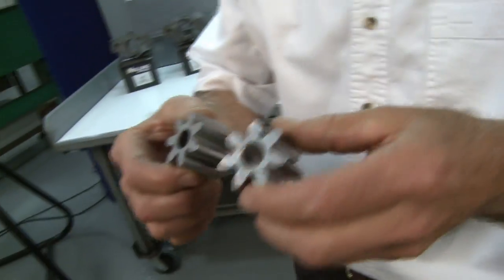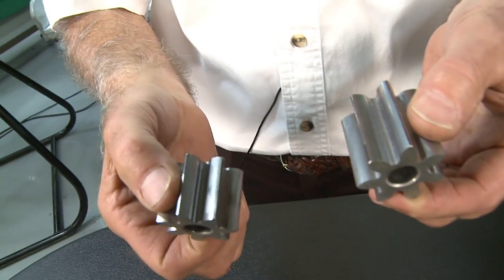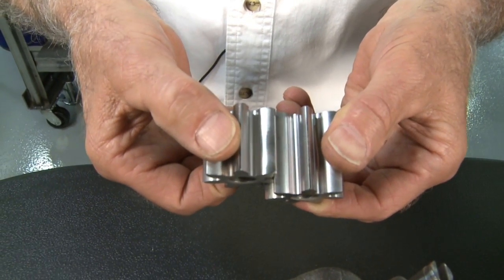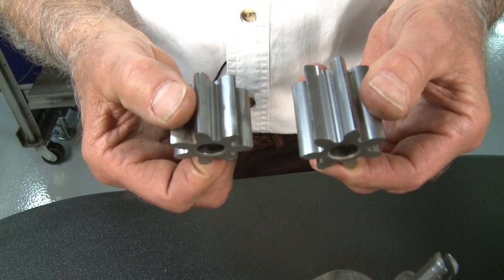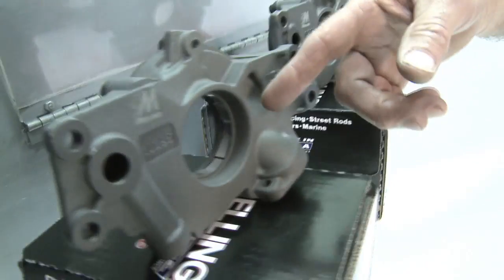These are the two gears out of the Chevy pumps. We've got the 1 inch 500 thousandths and the 1 inch 200 thousandths. It's really obvious to see the length difference in the gears, and it's that length that produces the difference in volumes — the difference between a standard volume and a high volume pump. The same theory applies with the over-the-crank pumps: the thicker the rotor, the more volume.